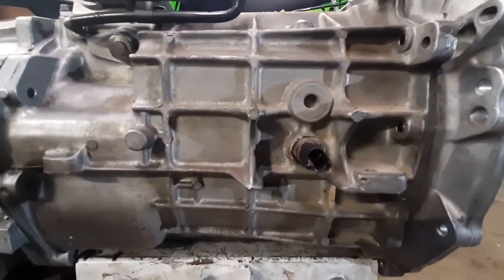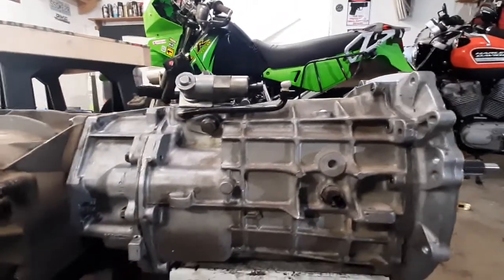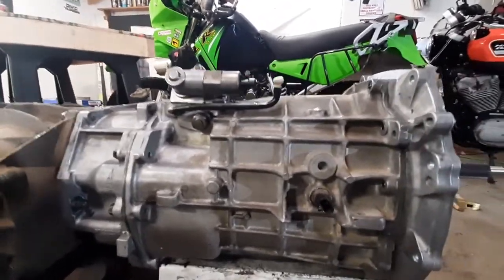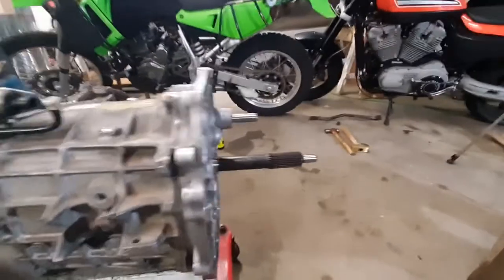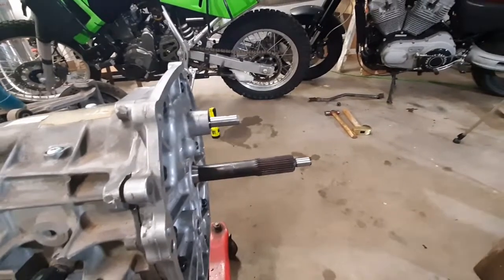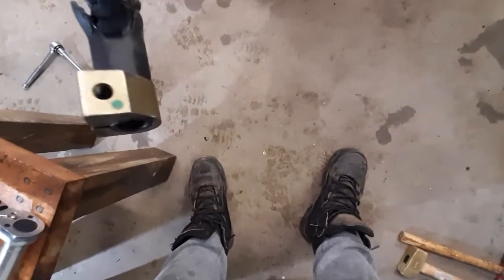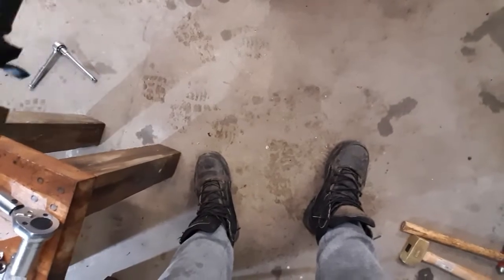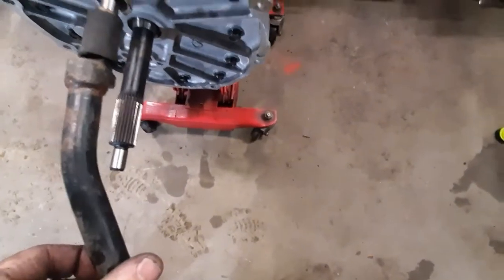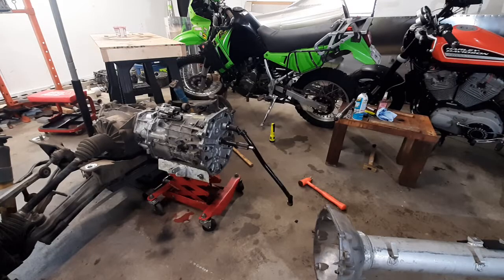That's all bolted together. While I was thinking about it, I went ahead and put in my switch and put in the drain plug — make sure to seal up the threads good with whatever sealant you want. Now we're ready to put on the shifter rod, because that has to go on before the torque tube. This shift arm slides on with the jaw going away from where the torque tube will be. Make sure the threaded part is down, and drive in a new roll pin.